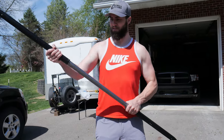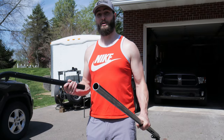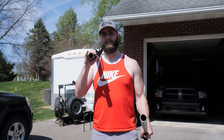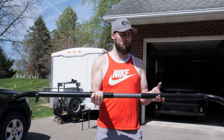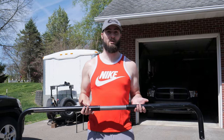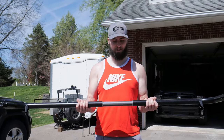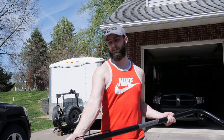We got in our piece of tubing. It's much thicker, so it's going to provide more support. The inner wall is just over inch and a quarter — this ID is inch and a quarter, this OD is inch and a quarter, so it perfectly sleeves over. I'll have the parts listed in the description; I got this piece of metal from Amazon. We're going to see where our length is. I'm thinking this four-foot tube shouldn't need to be cut down — I should just be able to slide it to where I need it, but I can cut it if I have to.